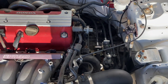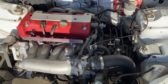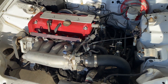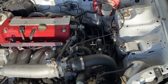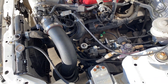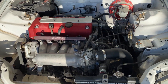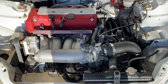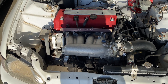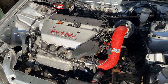As you can see on the Z1 build, it does have an external fuel regulator because it's using the stock tank — the single cam had a fuel regulator on the rail itself, so that's how it was regulated. The mounts on this one are Avid mounts, which I don't think they make anymore — they were a cheaper brand at the time compared to Hasport, around $280 versus $500. This car is pretty much fully modded with K-Tuned headers, K-Tuned intake, shifter cables — though you don't really need all that; you can run stock same as the 2002-2004.